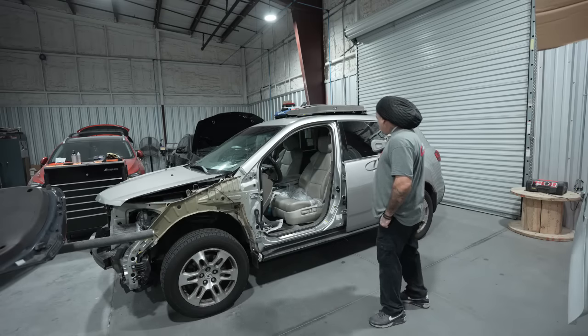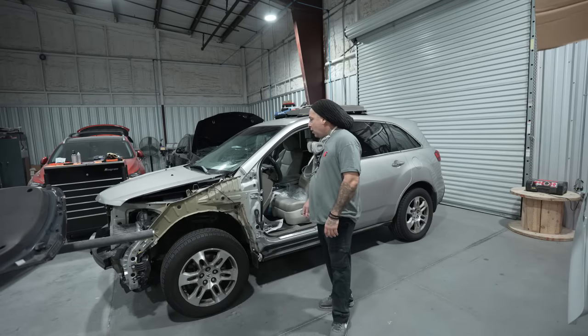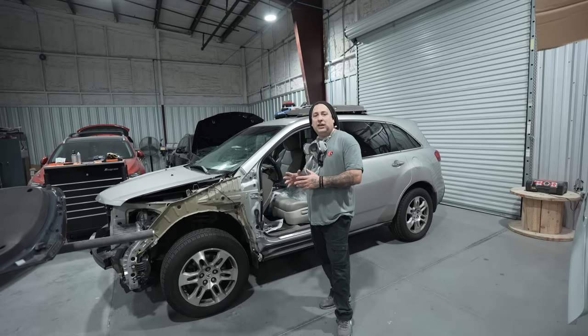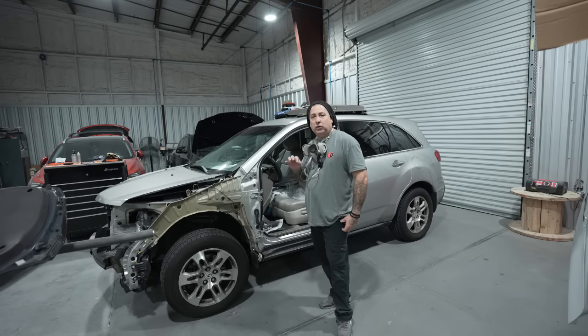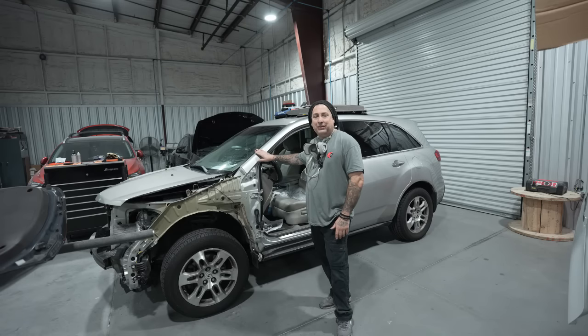So first thing I did was bring my camera over here, knowing that we do not have chips to compare that to. So once we took a camera shot, we went back over to the vehicle, and I'll show you guys the parts, what we did. We buffed up our panel like Glasurit wants you to do, so that camera can get a good match, because if you have scratches in the clear, it's not going to be able to see that color the right way. So we did polish it up. That's a big thing you want to make sure that you do when you're using this paint and the camera. Don't just clean the panel and go over there and hit it with the camera, because you're not going to get a true reading without having that clear as shiny as possible. And this is an older vehicle, so we had to do the one-step compound to get it polished up.